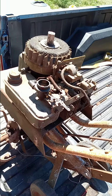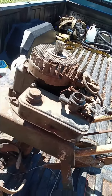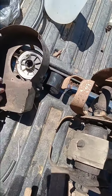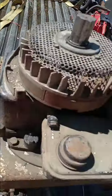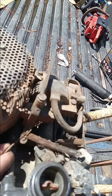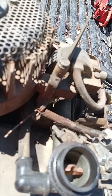I got that shroud off and got in here. Somebody's been in here before. The three shroud bolts that hold this cover on, they were all finger tight. And now that I've gotten in here, somebody's taken this linkage off the carburetor for the governor and just let it sit there. So that wouldn't have been good.